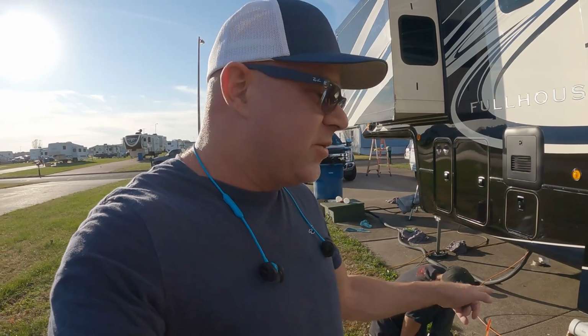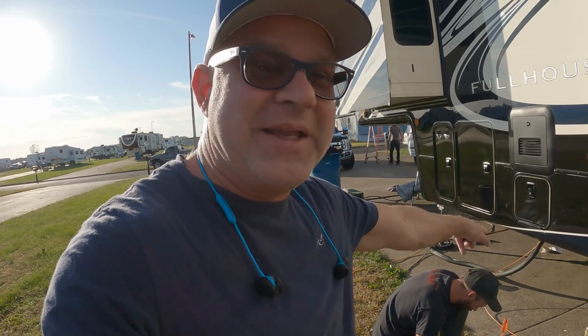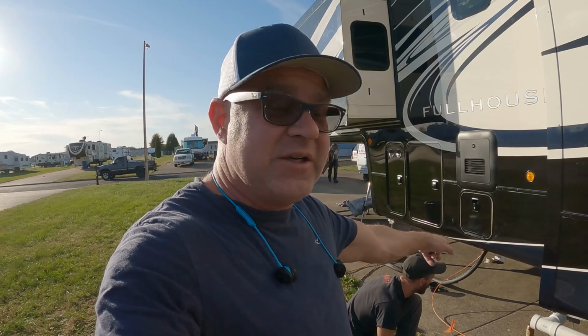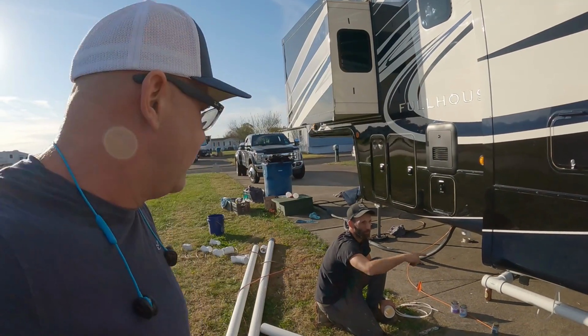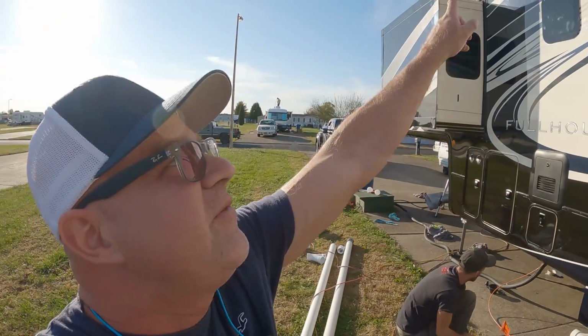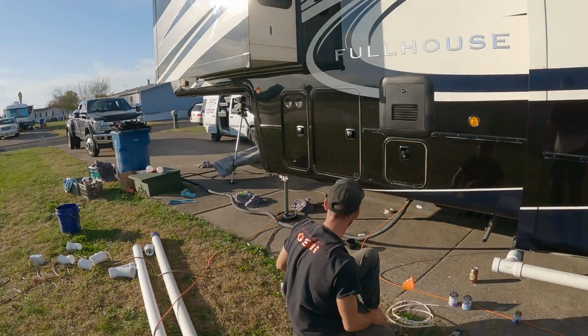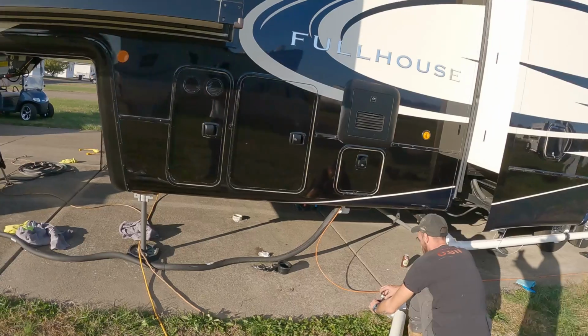He explained to me I had them collapsing on me. When I'd open one, the other hose would collapse. Well, it was sucking air out of it because I had it completely sealed, right under my rig. I was thinking, let's seal the crap out of this so there's no fumes coming up in the rig, but it seems it needs to breathe. Yeah, there should be a vent in there. We have a vent that goes up, but it's like putting your finger on the straw. So don't overseal your connection, in other words.